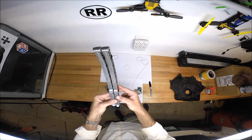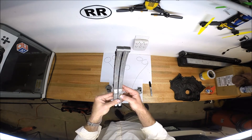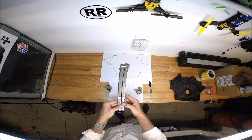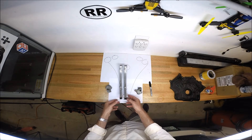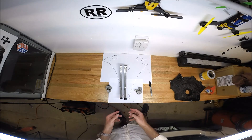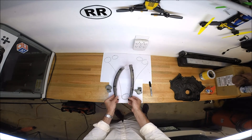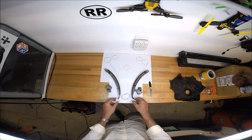So this is what's going on inside the Ford 5-liter engine on the timing chain guides and why they need to be replaced at around 50,000 miles. The symptoms again: you have a rattle, a click, or a ticking noise from the front of the engine. It's typically on cold startup and at idle that you'll hear the noise.